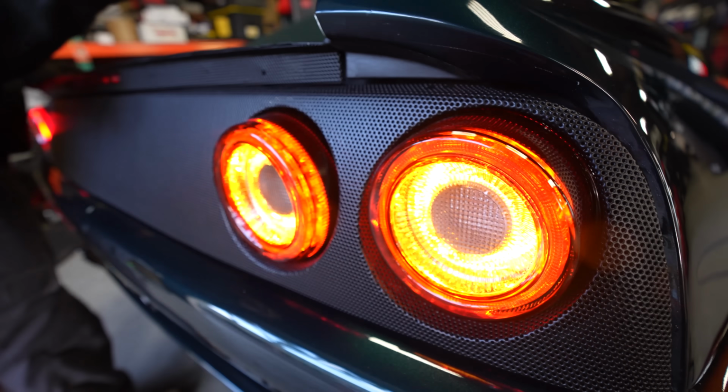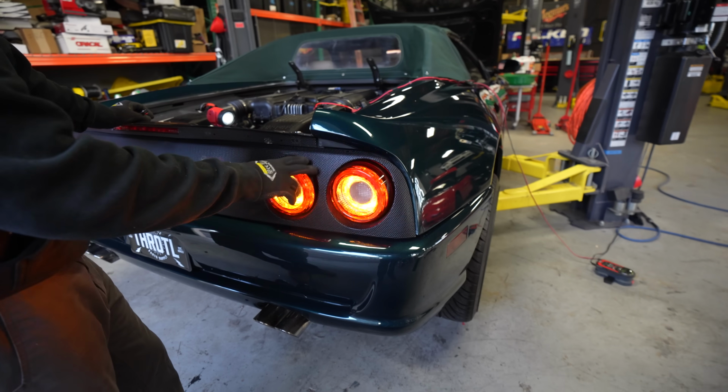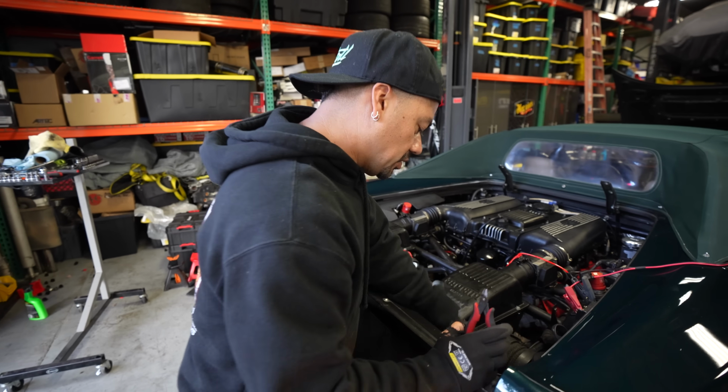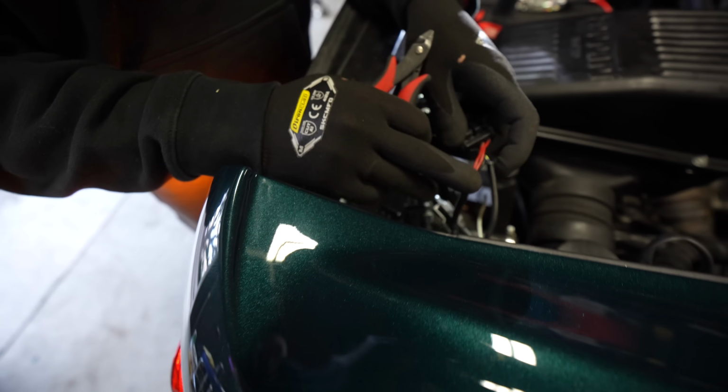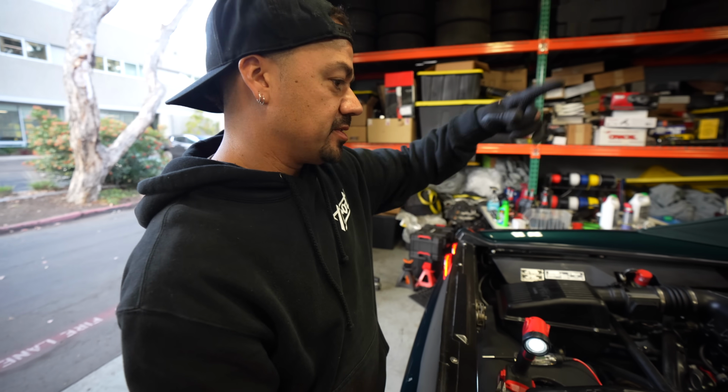Signal now, Mr. Ricky. Yeah, make progress. We didn't have turning signal or parking light. We only had brake light. So now we have brake light and turning signal, still no parking light. And I did notice that our harness has no power whatsoever. So the issue is past the system, past the harness. So I have to trace this back to wherever it plugs into.